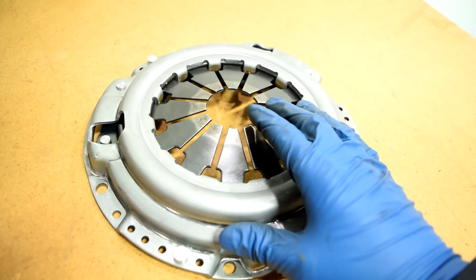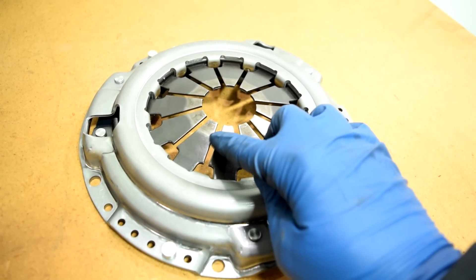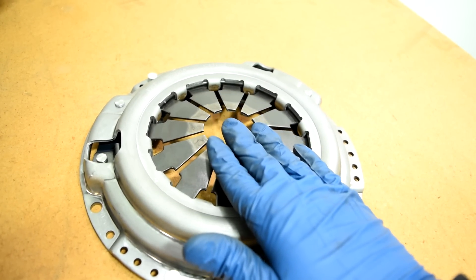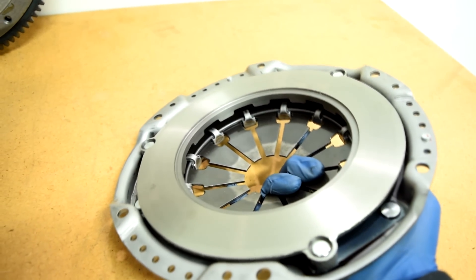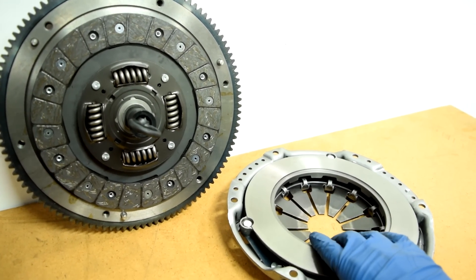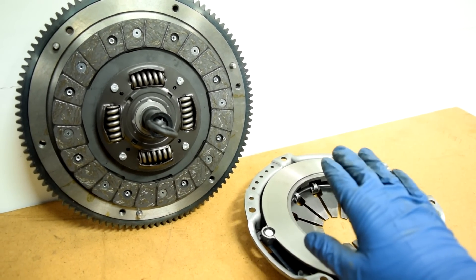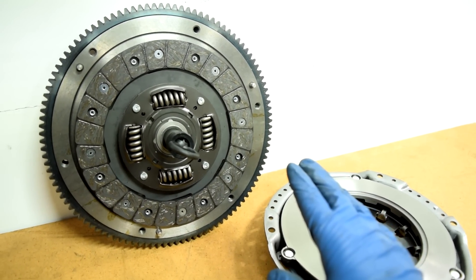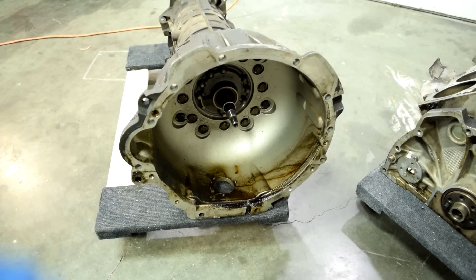Also, if you have a hard time putting your car in gear, or maybe you hear a grinding noise when you put it in gear, and at the same time you don't have a spongy clutch pedal, that can sometimes be an issue with your pressure plate. These fingers, over time, warp and bend out of shape. When you apply your clutch, they don't pull back enough on the friction surface, and therefore don't allow for a proper clutch release. One way to check whether that's your problem is to get a feeler gauge between your clutch disc and your pressure plate when the clutch pedal is applied and see if that clearance meets the specification for your car's make and model. A lot of times you'll have to remove the transmission to do that, but on some cars there's an access hole that allows you to do it without removing the transmission.